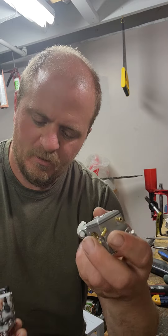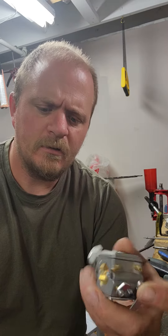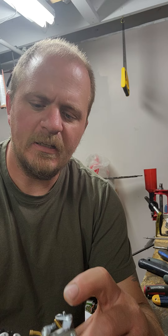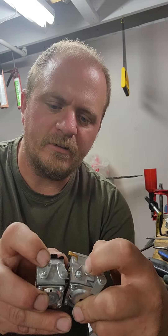There's going to have to be some mods done, because this carb is a little wider, as you can see. I'm also going to have to drill a hole and modify the linkage a little bit - not a lot, I don't think. It'll be pretty easy. Just a little bit of modification, basically just have to drill a hole into the throttle there.